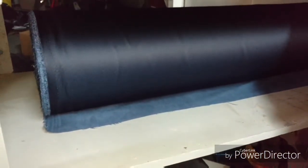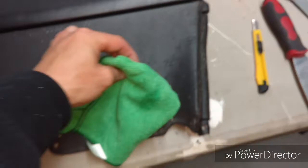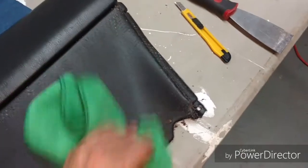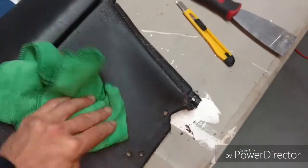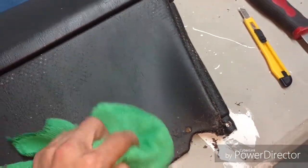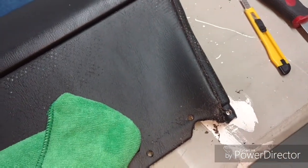I'm going to cut a good piece of Alcantara suede and start placing the fabric. First, take a little bit of lacquer thinner on a rag — just a nice little damp spot — and lightly rub so all the glue curls right off to a nice clean surface. You don't want to over-soak it; just enough to do the chemical removal with the thinner. Now it's nice and clean and smooth — we can put a coat of glue right over that.